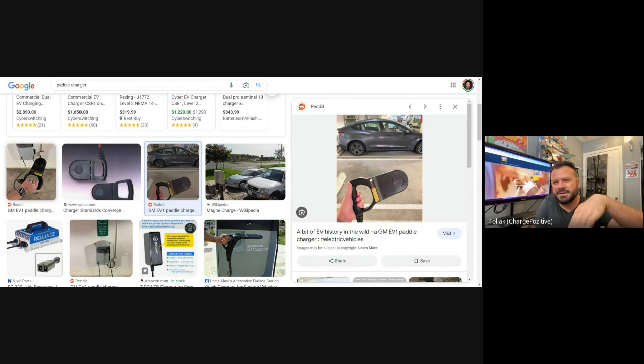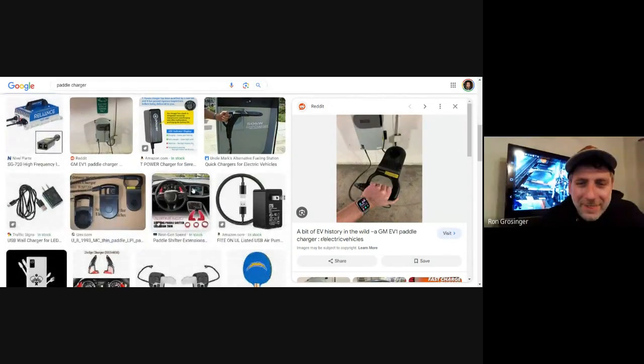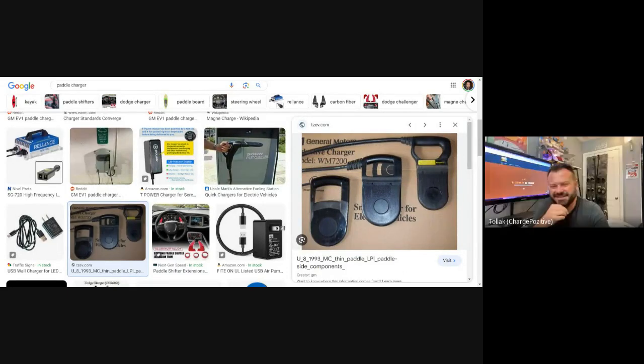They're inductive, right? Weren't they inductive charging? Right, it's inductive. It doesn't have any external conductive contacts on it. There have been problems with them before where they get hot and they actually melt things. So you kind of have to be a little bit careful with them on the older cars. You have to make sure everything's good and clean. But I actually saw one of those chargers when we were up in San Luis Obispo for Tesla Takeover this summer. Nice. No kidding.